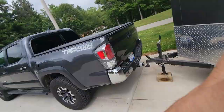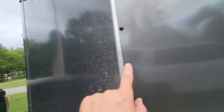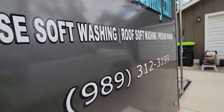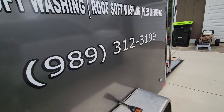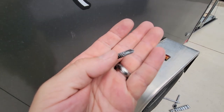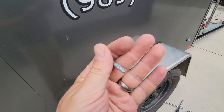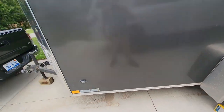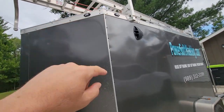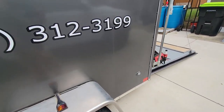You'll want to have some of these — these are all self-tappers. Everything on here is basically a self-tapper type scenario for the screws. They don't pre-drill these holes, they just run self-tappers. A self-tapper has a cutting end on it — that end is designed to drill as it goes, and then the threads start. So it actually drills the hole and puts it in at the same time. They work fantastic. Having size 10s and size 12s — three-quarter inch and one inch — available for a trailer definitely comes in very handy.